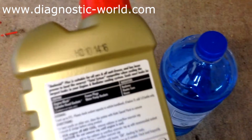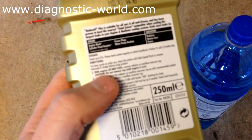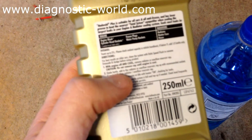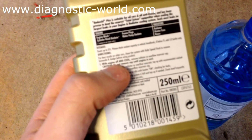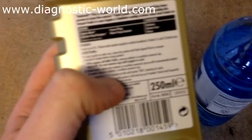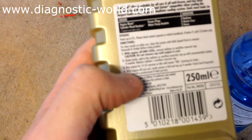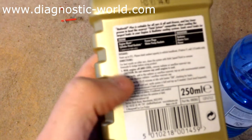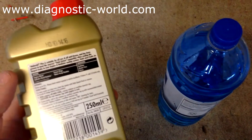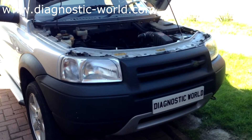The first step: engine off and cool. Remove the radiator cap, then shake the bottle and add this to the reservoir, then top up with coolant. Then we need to run the engine for 15 to 25 minutes with the heater on. After that, with the engine off and cool, verify the system is full and top up if needed. We need to wait for the engine to cool and check the expansion tank to see if it's still full. Okay, this is our Freelander.